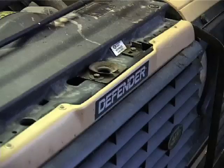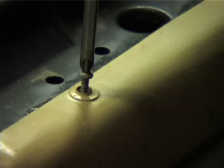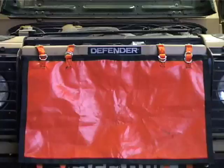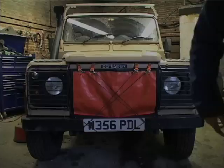Now for a slightly easier operation - fitting the wading blanket onto the front of the vehicle over the radiator. All you need to do is remove the four screws on the slam panel and they simply pass through the fixtures on the straps with a washer underneath, mounting directly over the grill. It comes with elasticated straps so you can attach it in the best way that suits your vehicle. It can be rolled up out of the way when you're not wading and easily dropped down when you are.